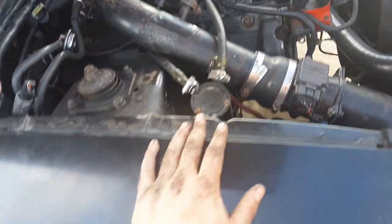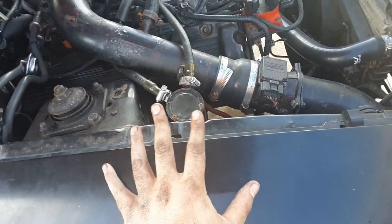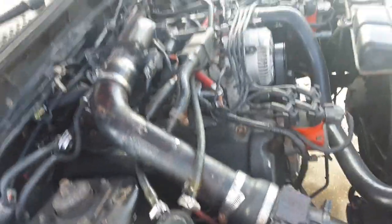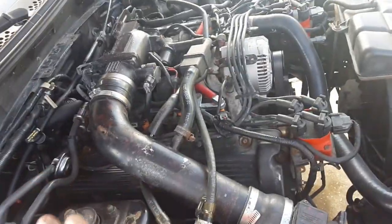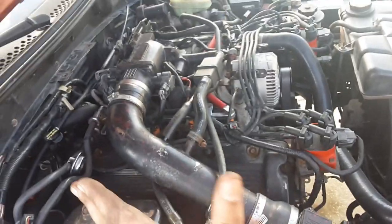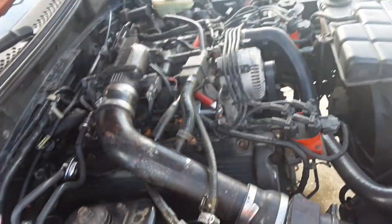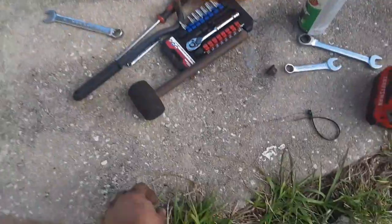Couple of things I will go over that ThatLowDsg may have covered, I'm not sure, but I found it easier to use a heavy duty tape. You can even use double-sided. Just use it at spots where it's not a mating surface. Put the gasket up and let it stick. In the spots with the studs, the reason I had an issue, hang on one second, I have one right here.